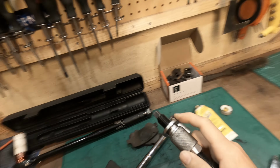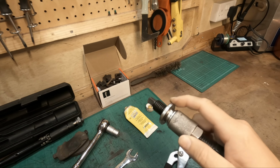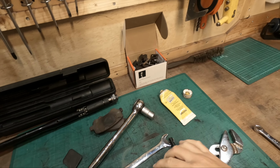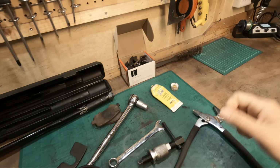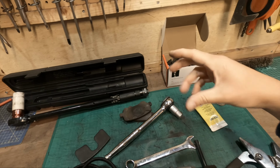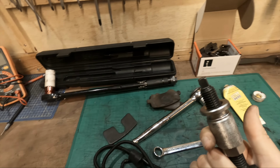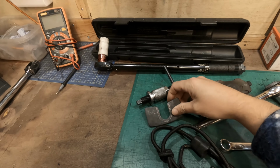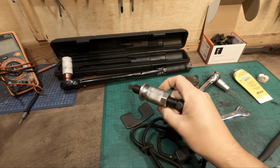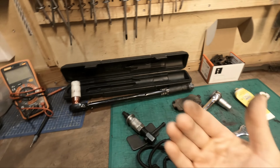Now, if you have successfully put the rear brake calipers into maintenance mode, you can technically, if you get a big enough set of pliers or a breaker bar, push the piston back. You don't have to rewind it, it's a pushback piston, but I just used a rewind tool, and basically you just put this in the place where the pad would be, as you see in the footage, and tighten it up. Once it's snug, just rotate the handle here and it'll gradually push it back.